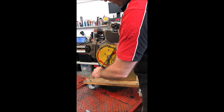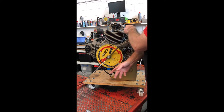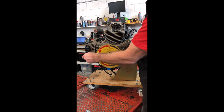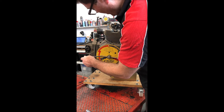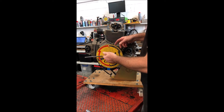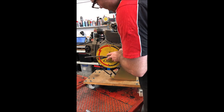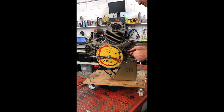That's 11 degrees. Coming around the other way, you can see the exhaust valve opening, and it will stop again — there, about 1 degree. So that's 12 degrees total, meaning our degree wheel is off a few degrees. We'll nudge the degree wheel off a little bit to correct it.